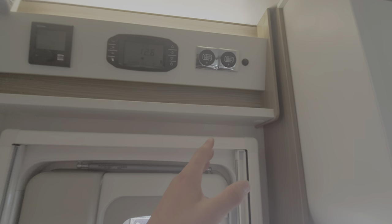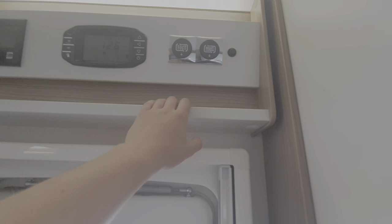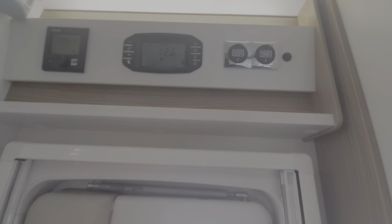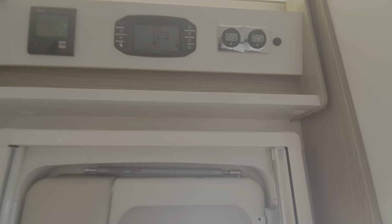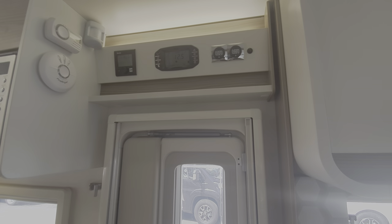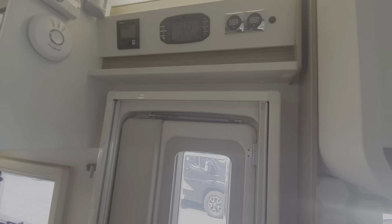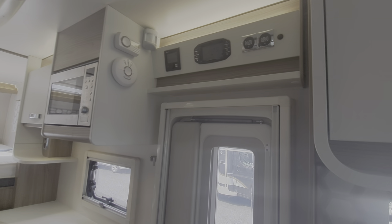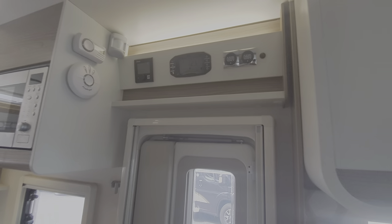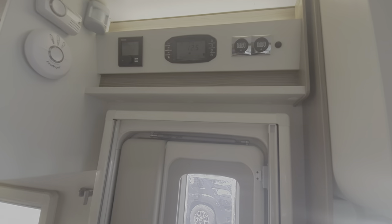All your drain-down points in this vehicle are all done from the inside. You've got a fresh water drain-down and also a waste water drain-down. All you need to do is click that button in and that will drain down the fresh water, and do the same thing with the waste to drain down the waste water. You have got a boiler drain-down point which is just in the back of the vehicle, which I'll show you later. The importance with having these drain-down points is a main priority — you need to make sure that in the colder months, no water is remaining in the vehicle. If there is water in the van and it's not been drained down correctly, you will get frozen water in the system and then it's new tanks that will be required because they'll burst the pipes. So please make sure that everything is drained down. I recommend that when you are moving off-site, always drain down, because that just gets you in the habit of draining everything down. Obviously the vibrations of the road are going to get all that water out.